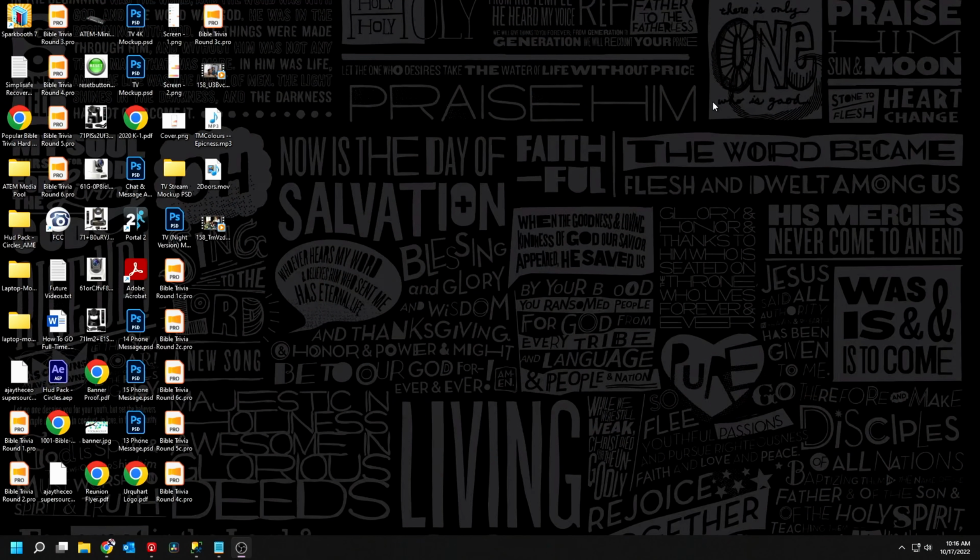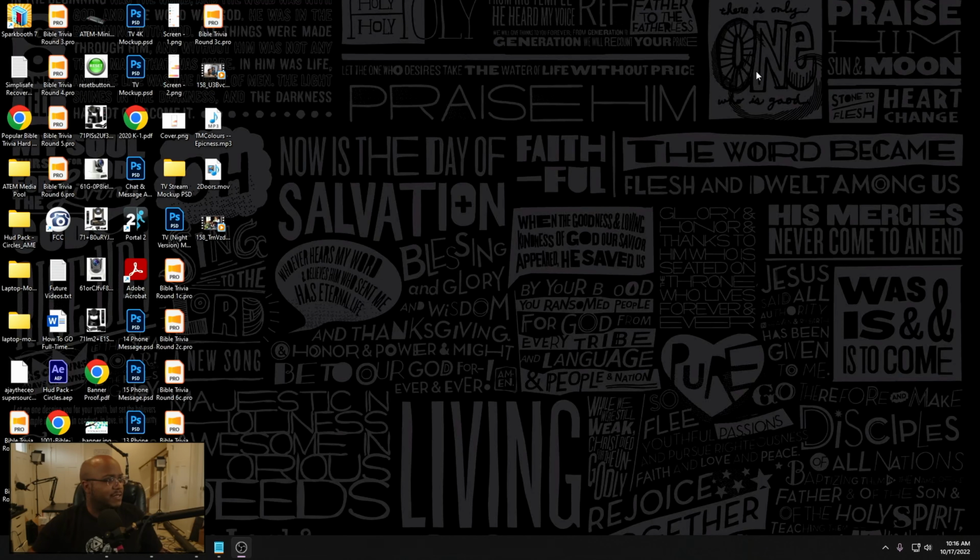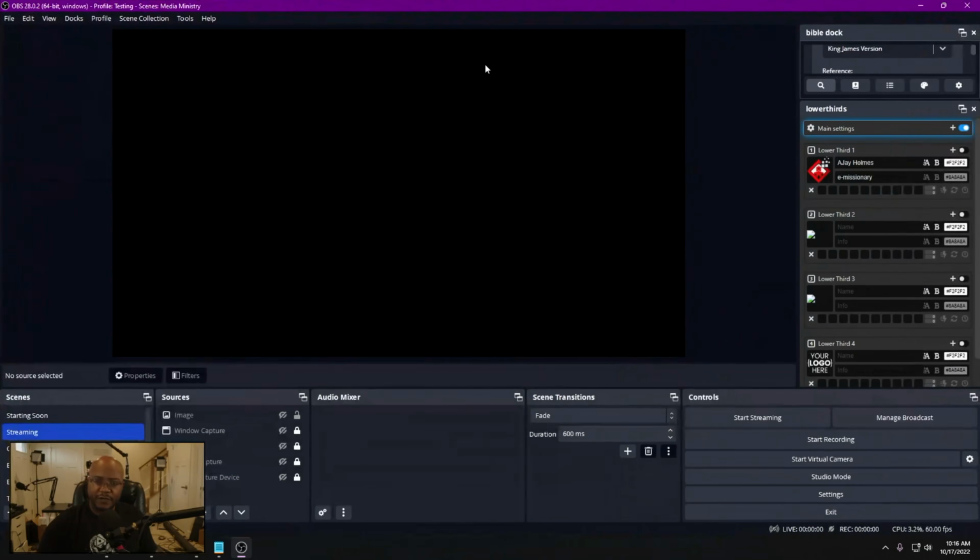I have our little mini HDMI capture card. So I'm going to go ahead and connect the camera to that. And let's see if we open up OBS, can we get a signal with that? That way we can verify if that is the problem or not. All right, let's turn off our display. Let's bring OBS over here. Let's connect this to our computer. And I'm going to say the HDMI is hot. I can feel it. It's very warm to the touch.